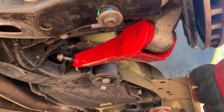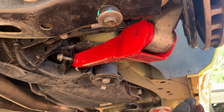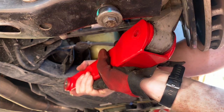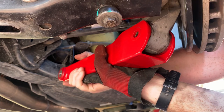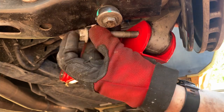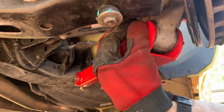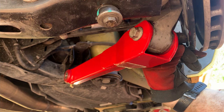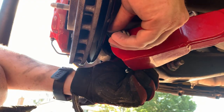Lower the jack back down. You have to take off the back bolt because this has to be adjusted. Then shimmy to get the hole lined up — it's about right there — and feed the bolt through. You'll need to pull with one arm to give enough room for the bolt to come through, the same way you did when removing the tie rod.